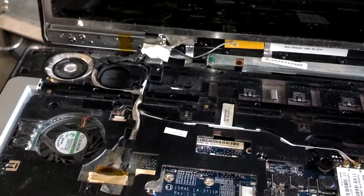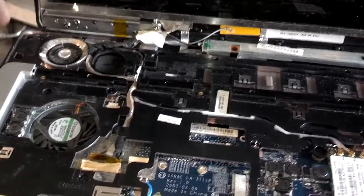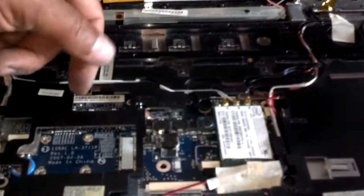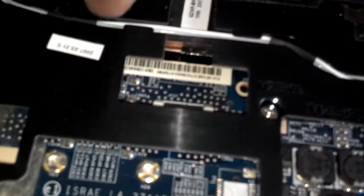When you're putting these screws in, just snug them down — don't try to strip them out or nothing like that. Once you get your cable down, go ahead and put your power strip in and plug it in and secure the snap on there. These things have to be pulled back so you can get the ribbon in there, and once you get the ribbon in there, then you push it forward like that to lock the ribbon in.